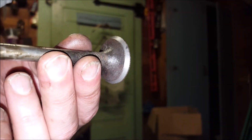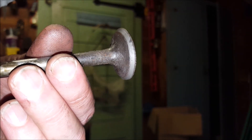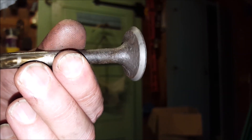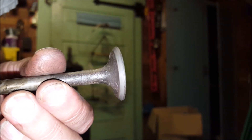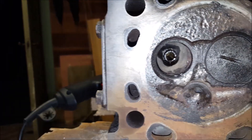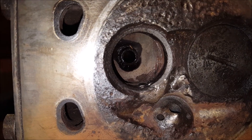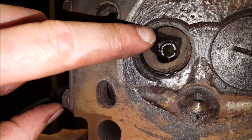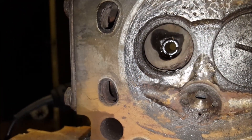On these other two I used the drill, and you can see how shiny it is all the way around on the valve — it has a completely new face right here. But it's still not quite right on the head itself. The right half is shiny, the left half is not — still very pitted. So we need to go a little bit more.